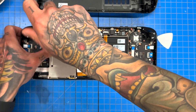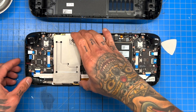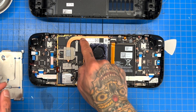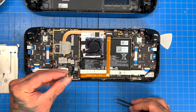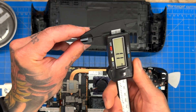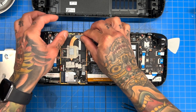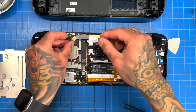If your Steam Deck is completely stock, all you need is to purchase a 1mm thermal pad. All you're going to do is place it along the top part of this heat pipe, right here. I already have my thermal pads cut — this is a 1mm thermal pad, maybe 0.9mm slightly compressed — and we just put it on this top part right here, then another piece right here.